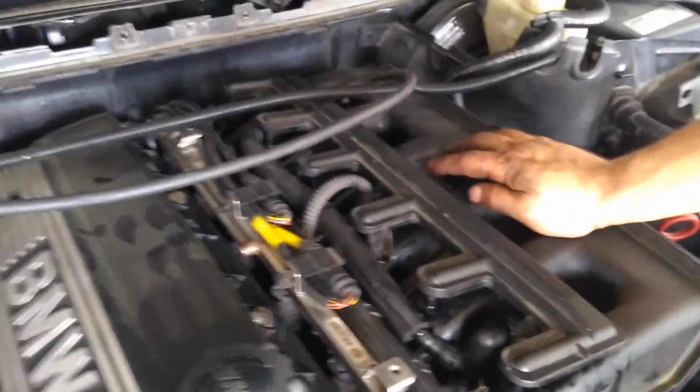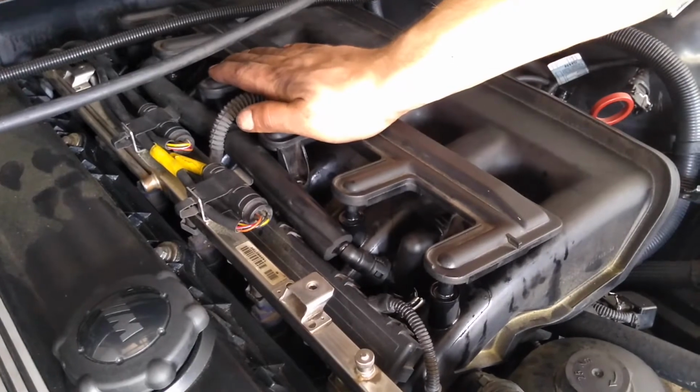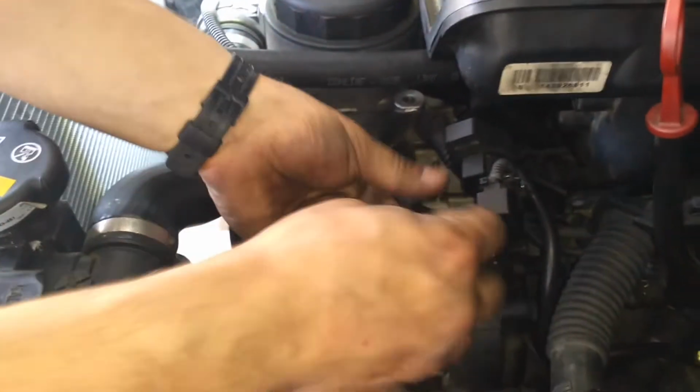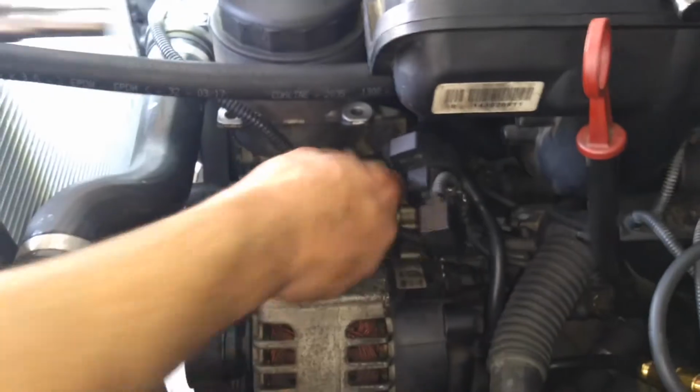Spray the O-rings on the air distributor with silicone to make sure they fit in nice, and then alternate your pattern of tightening the bolts to even the clamping force. Remove the long 10mm bolt underneath the oil filter housing. It will be replaced by the tilt bar.